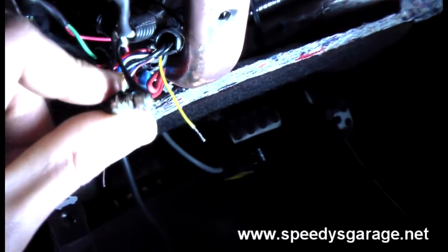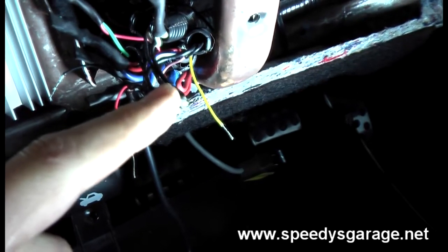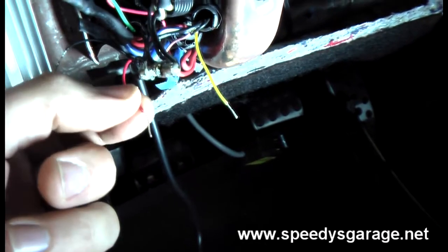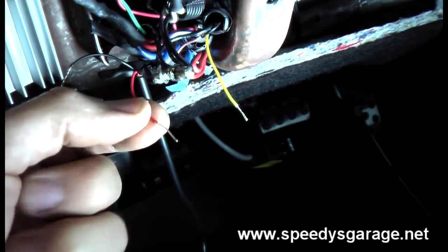You want to get access to your ground wire that you used for your LC1. You want the analog inputs to the Trinity grounded to that same point so that you don't get any kind of voltage shift. The red wire, as we showed on the bench with the continuity meter, is analog input 1 on that 2.5mm stereo jack.